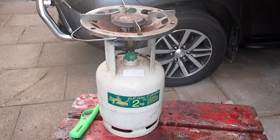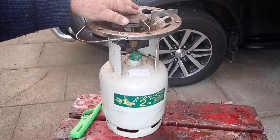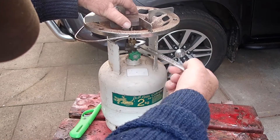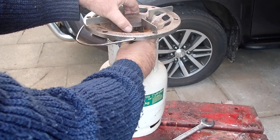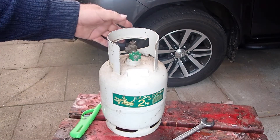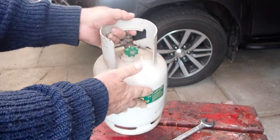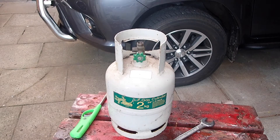I'll remove the unit from the gas cylinder and confirm there's gas flowing from the cylinder. This one uses a 19mm fitting. Now unlike your normal righty-tighty lefty-loosey, this is a gas thread - so you feel like you're tightening it up, but you're actually loosening it. With my thumb on the outlet, I can feel the gas pressure there. It's reasonably clean, so it's not the gas bottle.